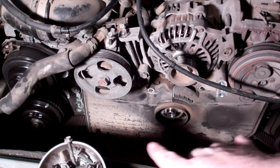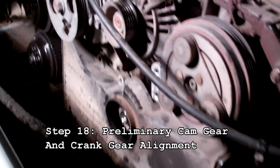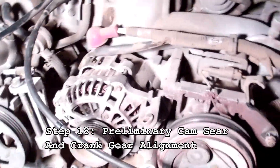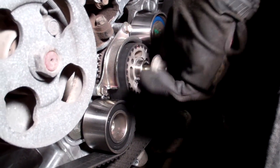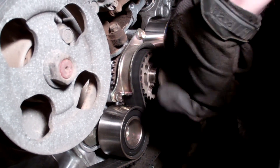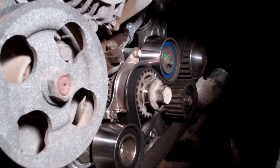On the bottom, pull out three or four bolts. Once that pulls out, we have the whole timing area exposed. We removed all the bolts from our center cover. Now we're going to put the crank pulley back in nice and snug by hand.